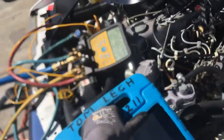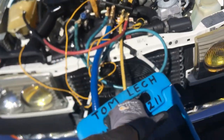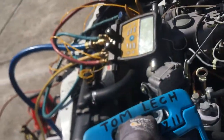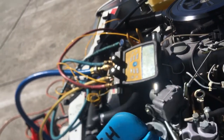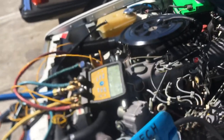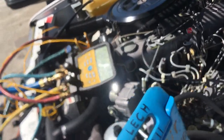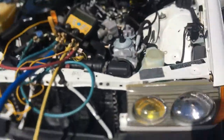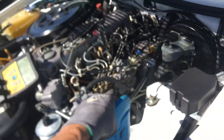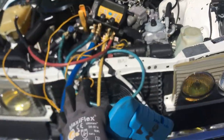The fan has to be off for me to check the fluid fan clutch — I have to wait 15 to 20 minutes. I have to disconnect the electric fan, get the engine and coolant up to temperature, and let the heat work on the bimetallic temperature wire that's located inside a thermal fluid fan clutch. You guys gotta study how a fluid fan clutch works. When I was a kid, my dad used to make me cut them apart. He made me take apart every part on a car. He did diesel too — we would take apart and rebuild diesel fuel pumps, and before that I had to study the factory book first. That's how I was taught as a child before high school.